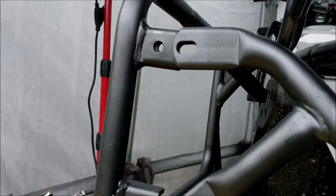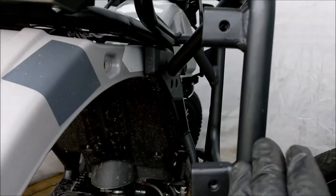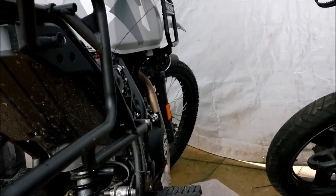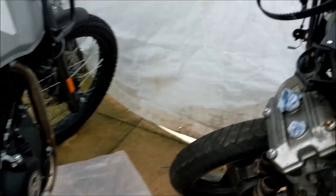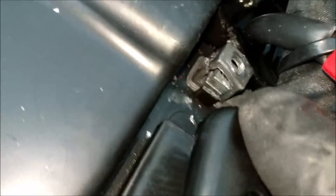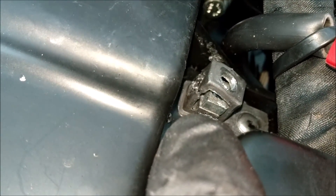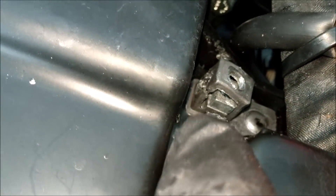You end up a good inch away because of that gap — this should be bolted up tight to this, which would bring this in. So I've got some cutting to do. Another thing I found: the instructions say disconnect the battery negative terminal first — fine, did that. Then I went to look at the positive battery terminal and someone has already cracked half of it and lifted that top end up.